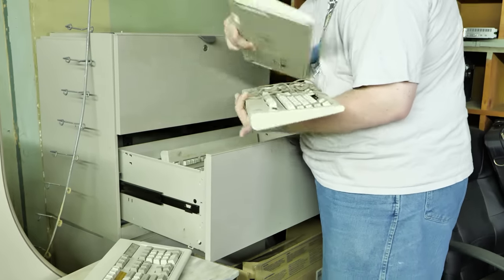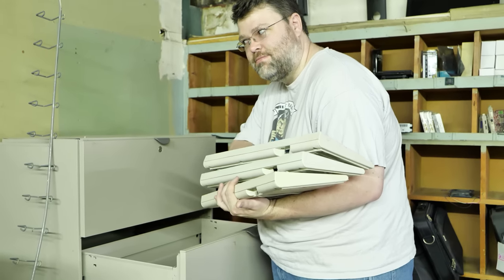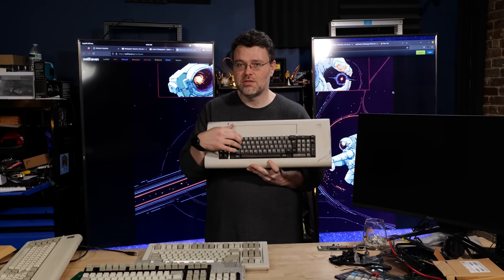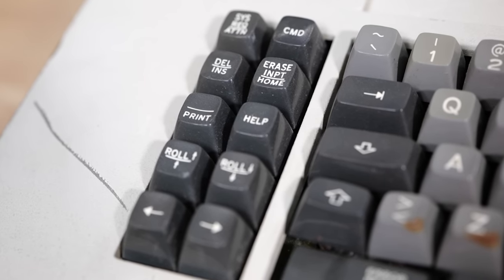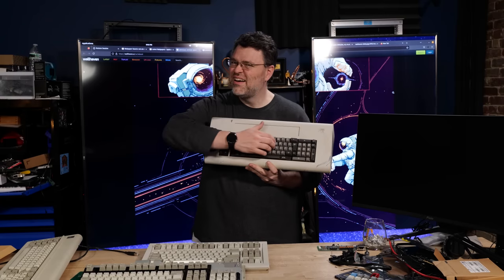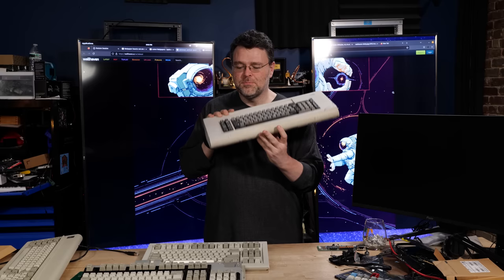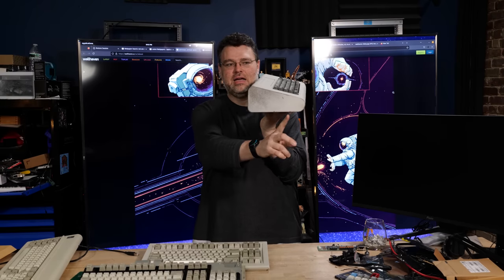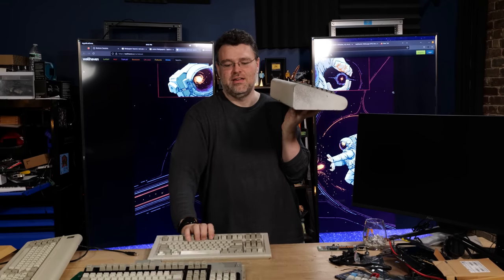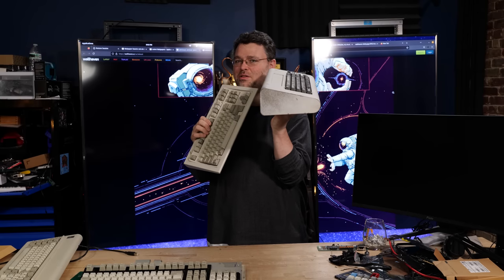Actually, I have an extremely extensive collection of Model M keyboards from IBM. They're great. But the beam spring keyboards, they're used on display writers, the data entry terminals, such as what this one is from. They predate even having the inverted T cursor. Yeah, the arrow keys are all sort of stacked on top of one another. It's not fun, but that mechanism, it's really interesting. And the beam spring key is so complicated, it really does necessitate this level of thickness. I mean, if you think this keyboard is a weapon, this is a weapon.